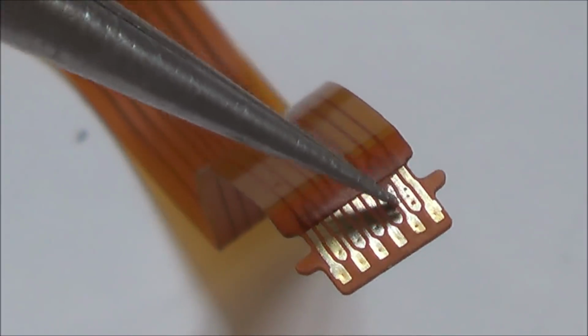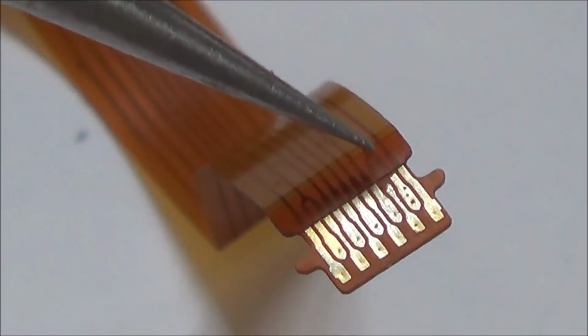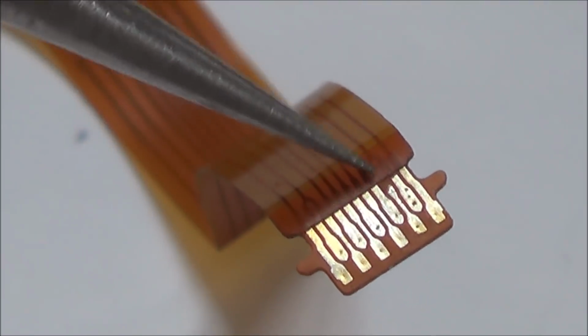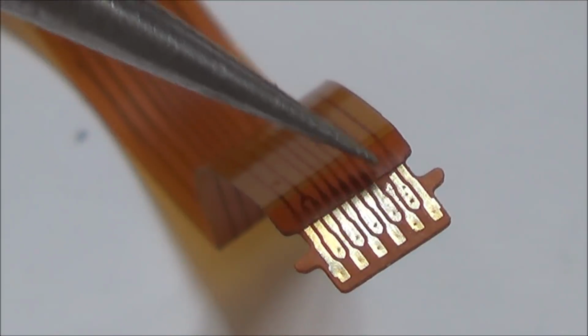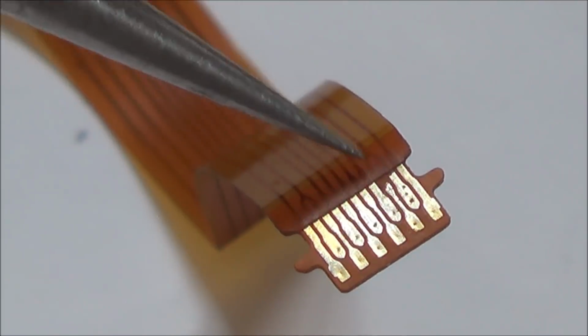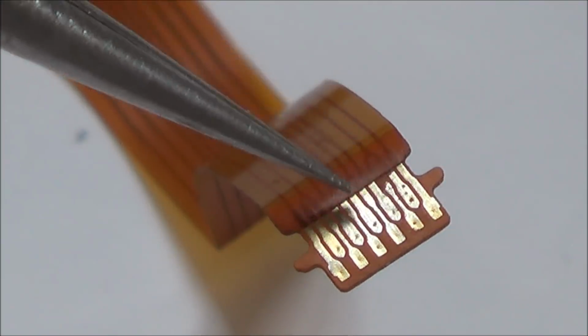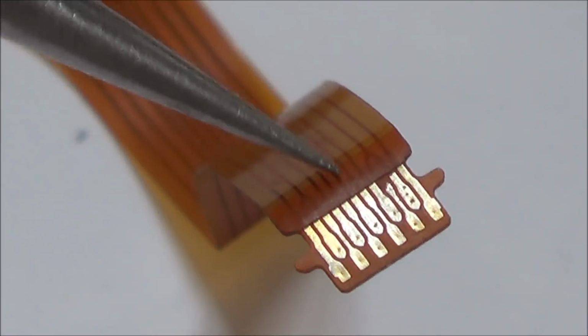So you can see that they're both broken here, away from here. I'm wondering if I was to sand it down here using that fiberglass pen, whether I would be able to put a bit of solder between these two, and this one here, because it both looks like they're on the same trace. So it would be easier to fix this one than, for example, this one here, because that looks like it's a wire for itself.